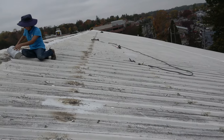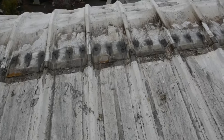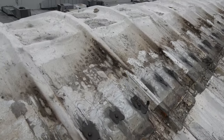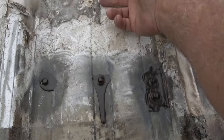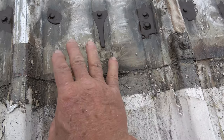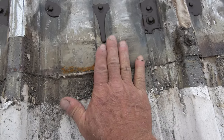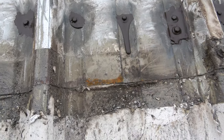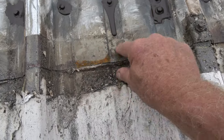Look at the acrylic coating they put on here — it's a huge roof and they had this problem from day one. Water condensates at the top of the building. It's a slanted roof and water condensates on the inside, then flows between the two panels at the seams and accumulates right here because the coating blocked it. Trapped condensation can't escape, and it's going to rust.